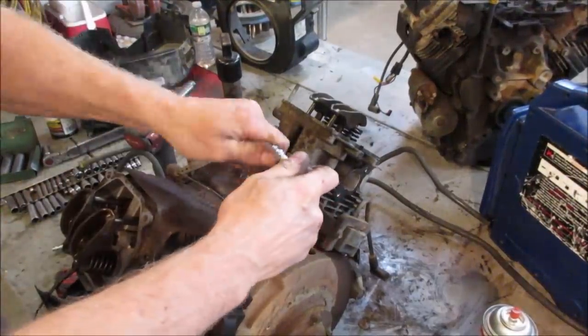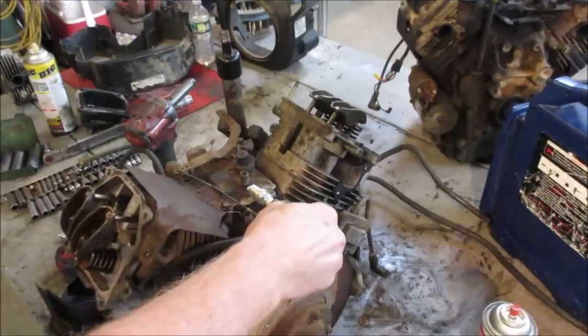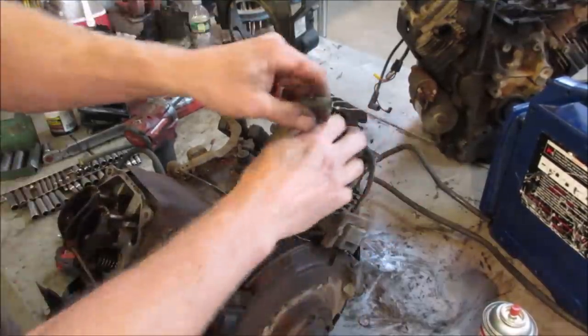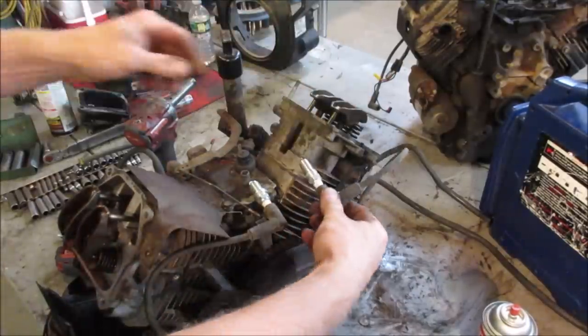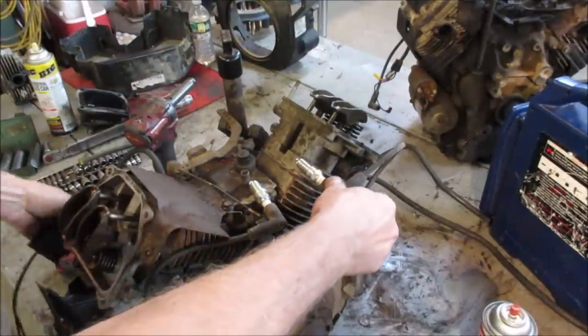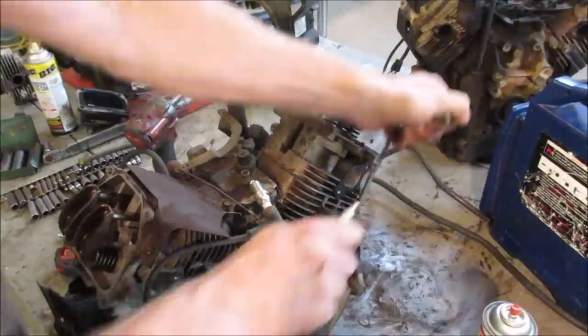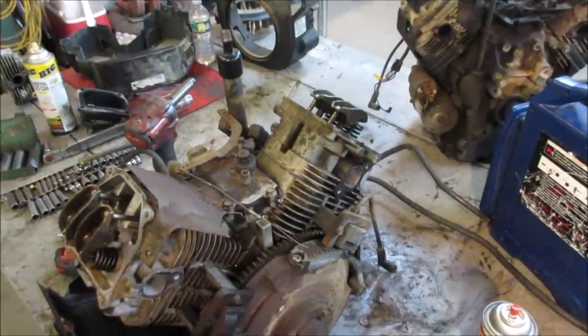Brand new spark plugs, Clark. Let's see if that gets this thing off. That one's good. How about your little friend over there? Yep. Spark on both. Let's go throw those plugs in real quick and we'll spin it over. Just kind of listen to the compression. Make sure there's no clunking.